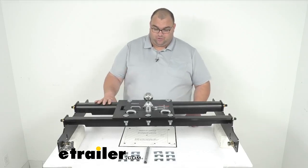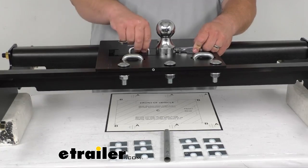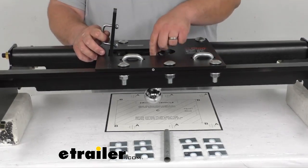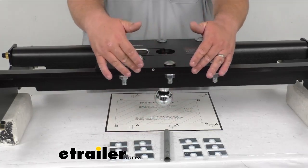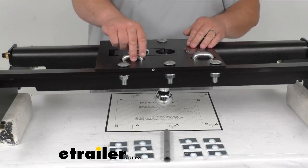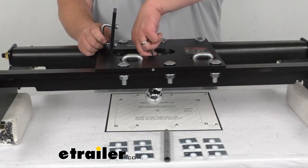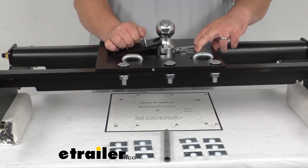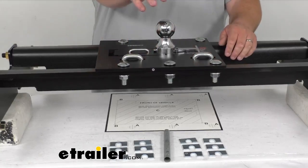As far as operation, I'm going to show you this at three different angles — we'll start with the close-up. You simply pull this lever here, it's spring loaded, pull that out of the way, pull up on the door here, fold the ball down — there are some grooves inside of here and it just slides right down inside that pocket, then you're ready to go. All of this is under the bed, hidden. All you're seeing is basically from this plate up. You've got your safety chain tie downs, those are spring loaded. To put it back up, you simply open that door back up with the pull handle, grab the T-handle, it pivots up, and put it back down in place. If you don't have it flat and locked back out, that's not safe, that's not fully locked. It has to be flat and locked back out — now we're safe to tow.